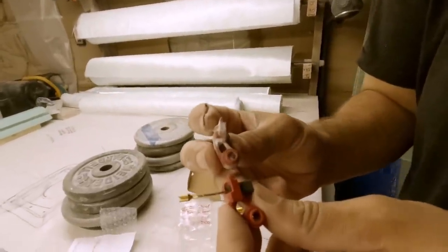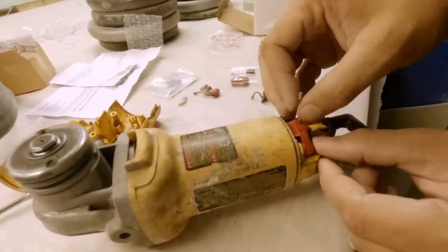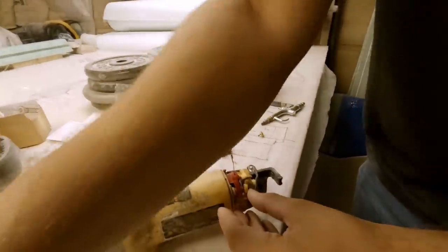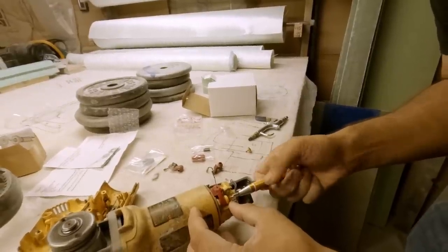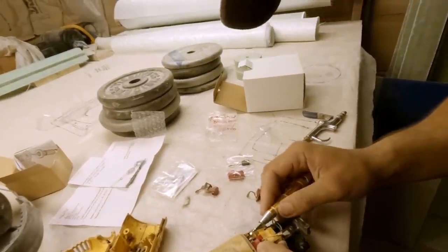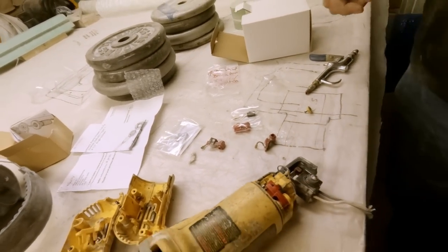Here's the new brush holder and brush - there's a little bit of a difference. I'd say they're a little bit worn. Pretty simple - there's a little felt gasket on that side, and on this side there's the same thing with a cap and a little Torx screw. Put that in there, pretty simple to repair, screw it in. A lot cheaper than buying a new one. There's a little spring here with a convenient tab that you spring up onto the brush - snaps right in, applies pressure onto it. There's a lead that just plugs back in right here and you're good to go.